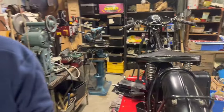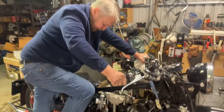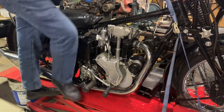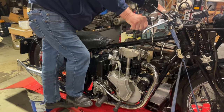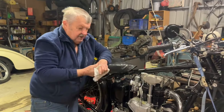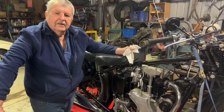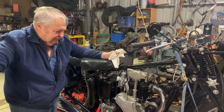I'll just show you what happens here. That is turning the motor over — no problem. Now pull the clutch right in — it's free. When you let it go, it's just slipping a little bit like it's supposed to, right on top dead centre. So just pull the decompressor in, let it go over, then kick it. In the manual it says: when you adjust your clutch, when you stand on the kickstarter on full compression, it should slip ever so slightly — and that means you've got correct adjustment.